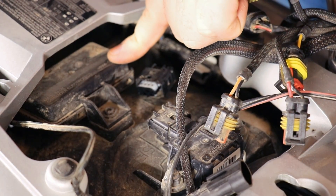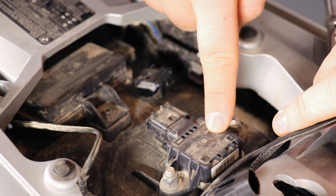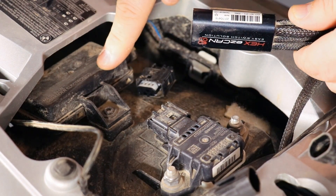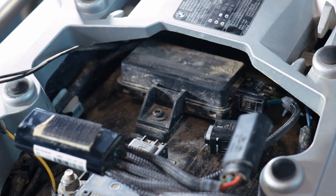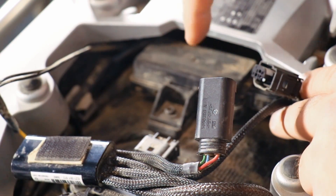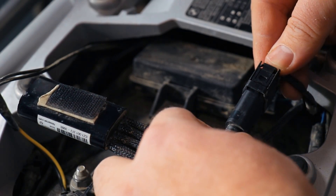You plug the EasyCAN into the bike using the RDC sensor connector — I believe RDC is your tire pressure monitor, and all the GS models should have that. You've also got the inertial sensor, which is what the lean-sensing ABS uses to detect your lean angle. This has the same plug as the RDC sensor — do NOT plug the EasyCAN into the ABS sensor; you need to plug it into the RDC one. Take the connector off the RDC sensor and in its place plug in the EasyCAN — it clips on very easily.